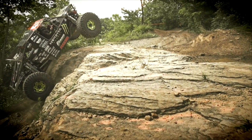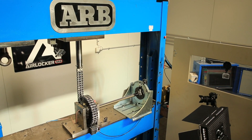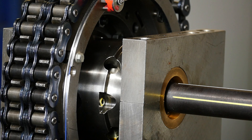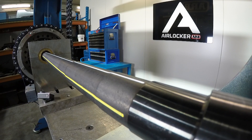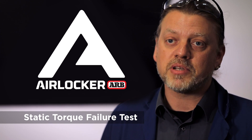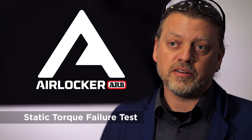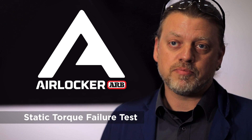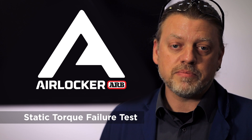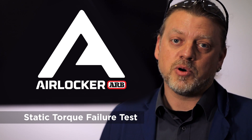It was an industry that was very hard to keep up with, and we saw breakages back then as all motorsport industries do. We designed and built this purpose-built test rig that can essentially take the entire rear end of a vehicle and put it under torque loads far in excess of what the vehicle can ever possibly deliver. In doing so, we can produce a failure of some component, and that allowed us to start picking the best components in terms of axle shafts. We broke a lot of products over several years, varying the design, the heat treat, the materials, and surface treatments — basically trialing every what-if in the book that an entire team of engineers could throw at the design. That's what's given us the motorsport product we have now.